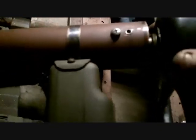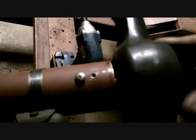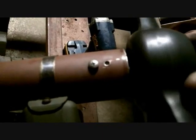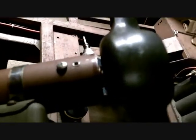So I drilled a new hole, and now if we put the steering wheel on, and get it to line up. Look at that. Well, when you tighten it down, it's right there. So it's that close. Probably like 1/8 inch away, which is good. It ain't rubbing. When we weld the shaft down here, the Jeep Laredo shaft, it's not going to be binding up any. Which is cool. I don't need a collar anymore.